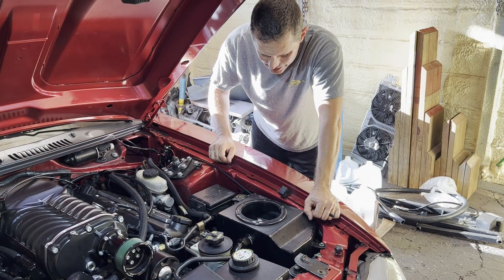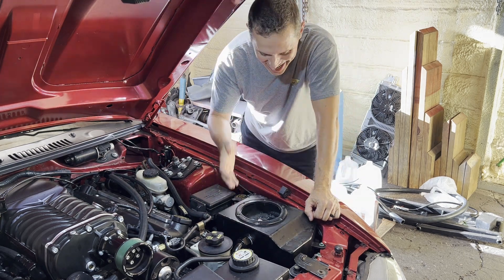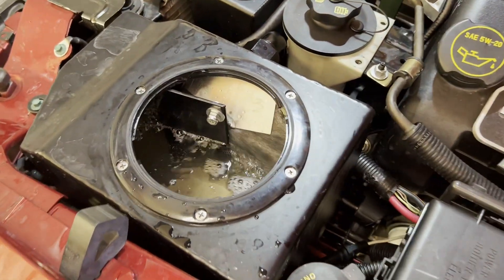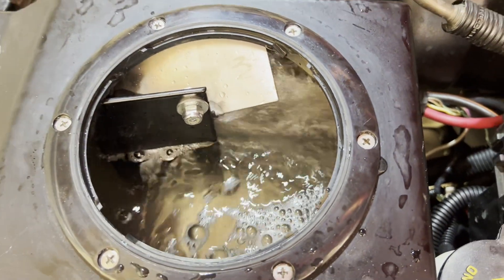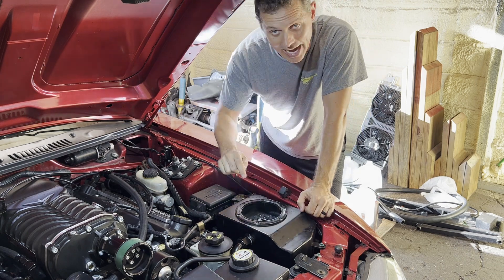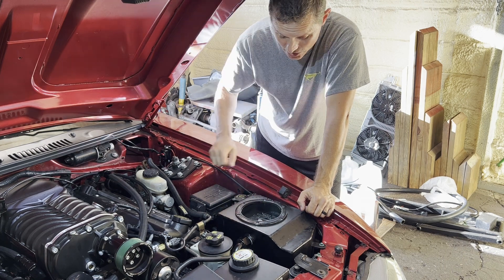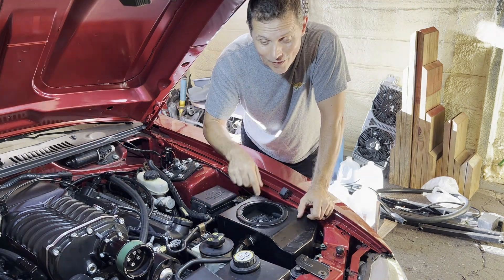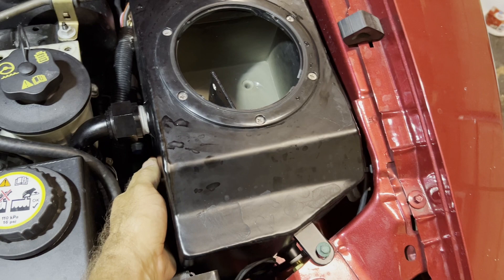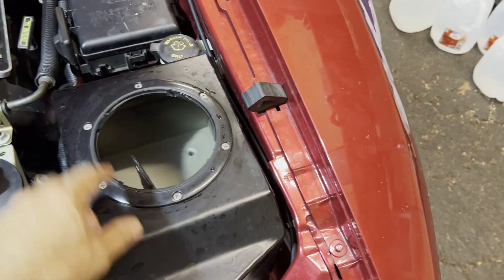The fluid is running, the pump is on, nothing is spraying out everywhere — you can visually see it's all working. More importantly, it's no longer blasting up on the lid like a power washer was hitting the back of it before. I think this might be the final key to getting this lid to stop leaking. Here's some footage showing how I made this happen. Because I didn't move the return down when modifying the reservoir originally, it still blew up too high and sprayed everywhere.